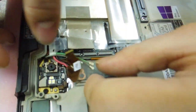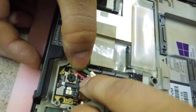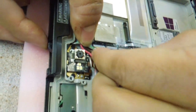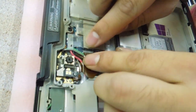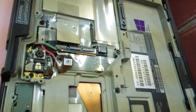Retape that down. And then you just got to put it back together. Slide the ribbon cable back in — it's kind of tricky with those other wires there. Once that's back in, press the little black bracket down. And you're all set with taking the card out.